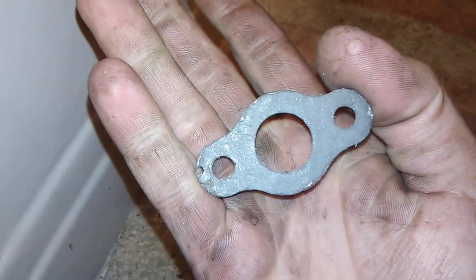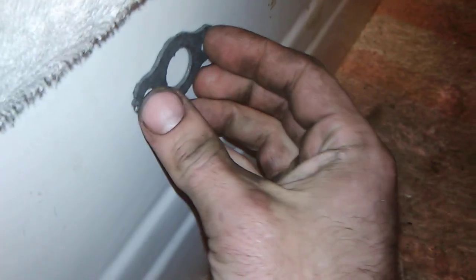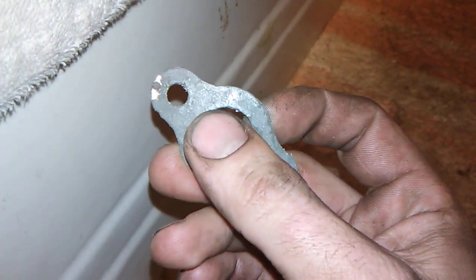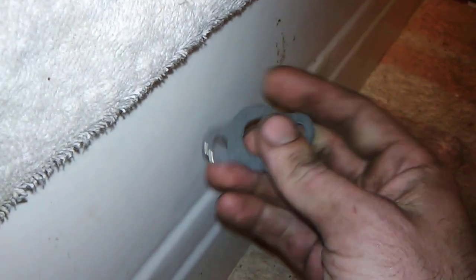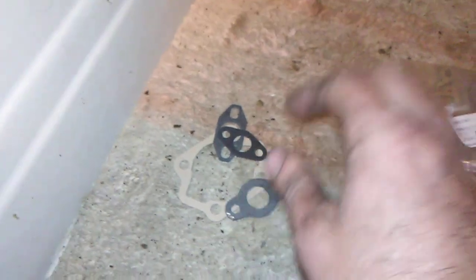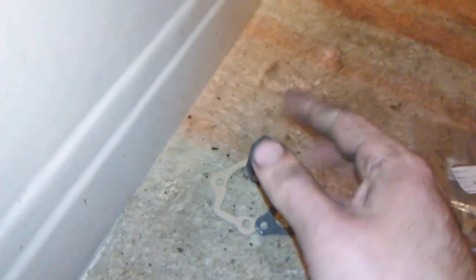Anyway, if you have old 80cc or 60cc parts, these work on the Phantom right where the intake is — just bolt it right on, then take your reed valve and mount it on there. Only use the ZT Moto-style reed valve, not the square box-looking ones, and it makes a complete seal. Tighten it with lock washer hardware and it works great.